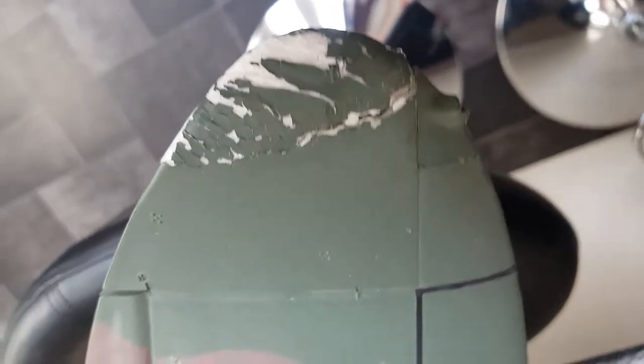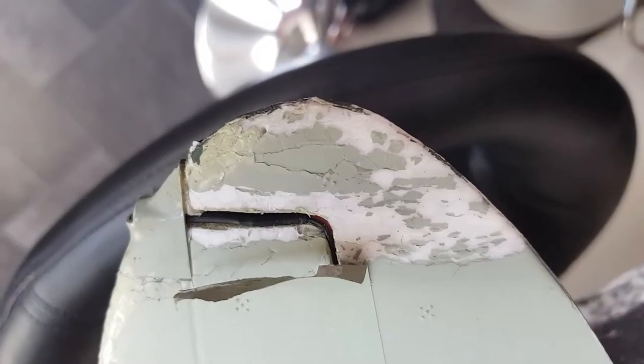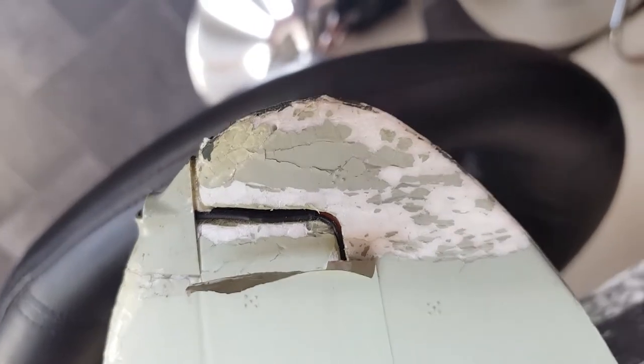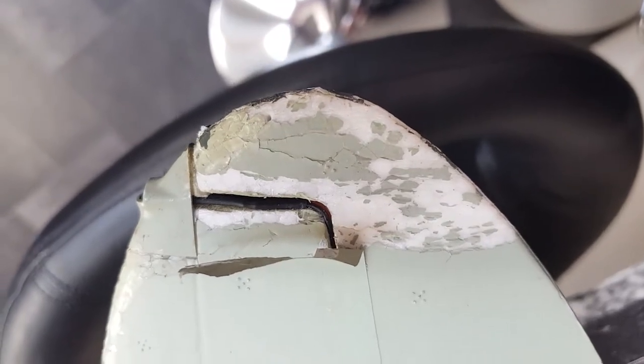When I was flying the Spitfire last, I caught the wingtip - just glued it on but it hasn't glued very well and it's crushed underneath as well. So what I think I might do is cut the tip off - I'll show you the underneath - cut the tip off because it's crushed all the foam. I'll glue a block of balsa wood on there and shape it down and paint it up. Should be great, so let's get on with it.